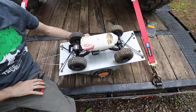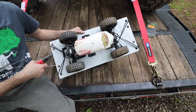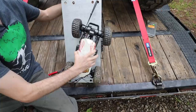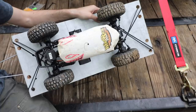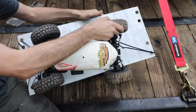Now, what happens a lot of times with straps if you tow a lot — something goes bad, either one tears, one breaks, one comes off. With a cross strap scenario, if you break one strap, it's all over. Not only is it all over side to side, but it's also over front to back — there is nothing keeping your Jeep or your car or your vehicle on the trailer. One strap goes down, your whole Jeep goes down. That's the problem in my eyes with cross strapping.